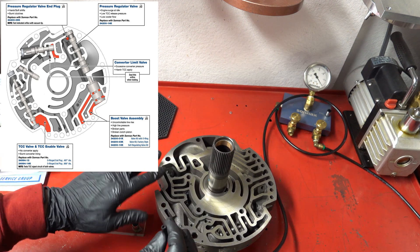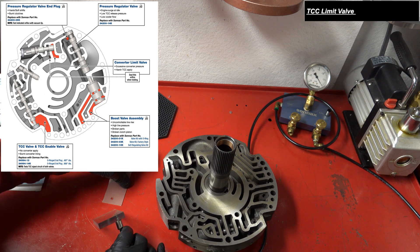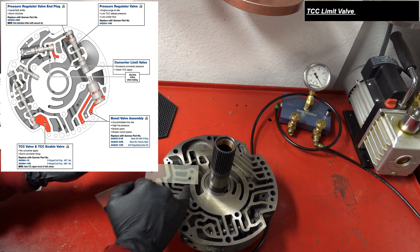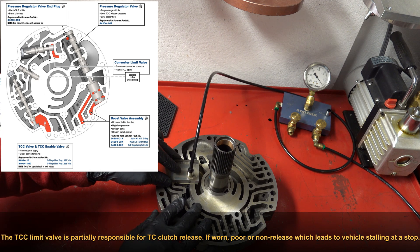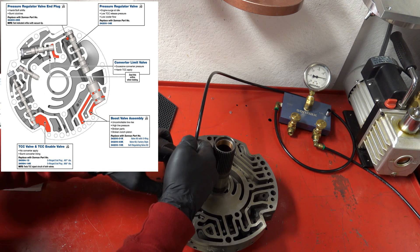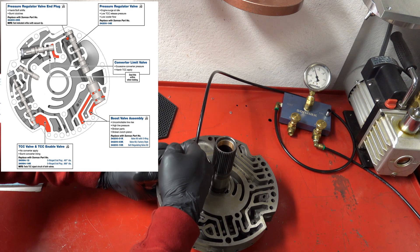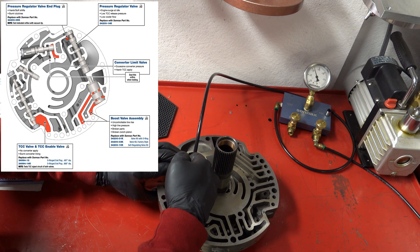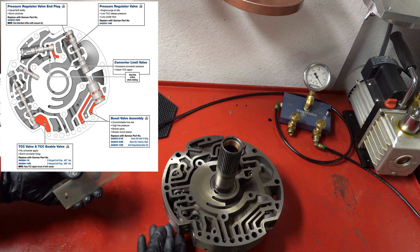You want to see 15 or more inches. We'll put it back onto the test block. The next circuit we're going to test is for the limit valve. Wait for the five inches to show — you can hear the air whooshing out of this little orifice — then stick a finger. Now we're sitting at 18 inches; take it away and it's back to five inches. That passes — two down and two more to go.